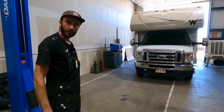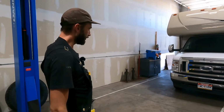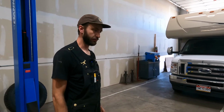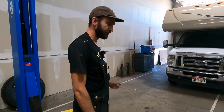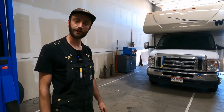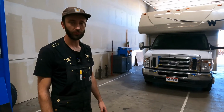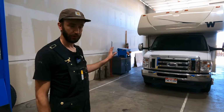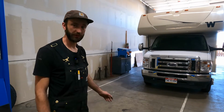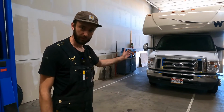Okay, and then that goes to the rear axle, which is a what in this particular vehicle? So this vehicle has a Dana 70 HD axle in it. So very serious axle. It's 456. More than likely, it's probably got a factory limited slip differential in it already. So generally on these things, we leave them alone unless somebody really, really wants a locker. We'll generally just leave the rear axle alone. This thing only has 4,500 miles on it, so there's nothing in there that needs rebuilding. Okay. Probably doesn't even need a fluid change yet.